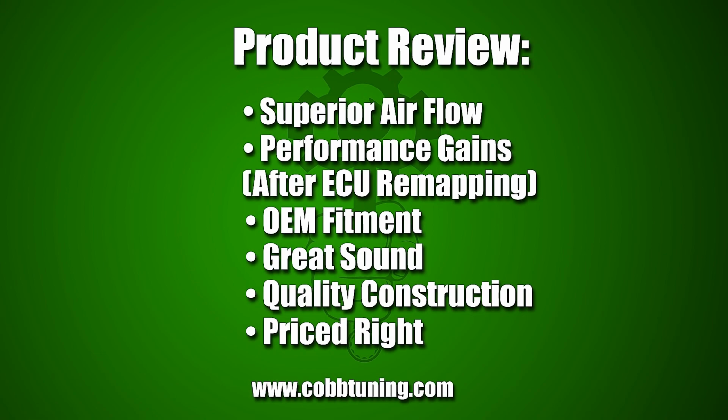Alright, this product got high marks in the following categories. Superior airflow. The full 3-inch exhaust and high flow cats open up the vehicle for additional performance-based modifications in the future. With higher airflow and less restrictions, the performance gains after the ECU has been remapped, I repeat, after the ECU has been remapped, are substantial. Something else worth noting on this is that this is OEM fitment. This exhaust paired up perfectly, all the way from the turbo studs straight back to the exhaust tips.